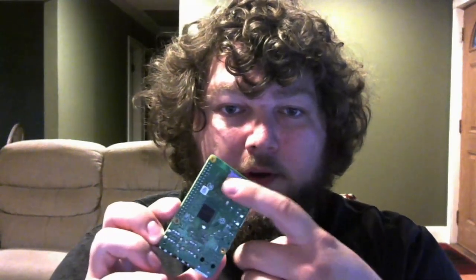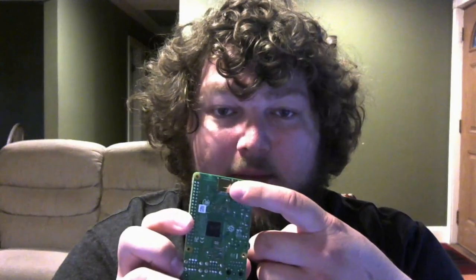One more thing I forgot to mention: underneath the board you'll see a little silver tab — that's actually where you put the SD card in. Take your SD card and you'll see the side with the contacts. Put that in so it faces towards the board and it just slides in. Now the SD card is in the Raspberry Pi and it'll actually boot up from the SD card. The power supply interface is right over here — that's where you plug in your power supply. Now you're good to power it up.